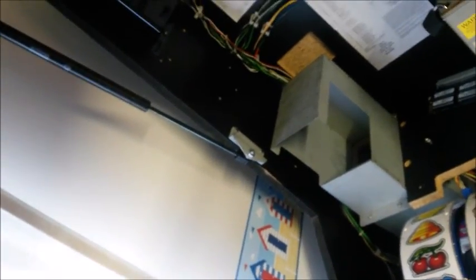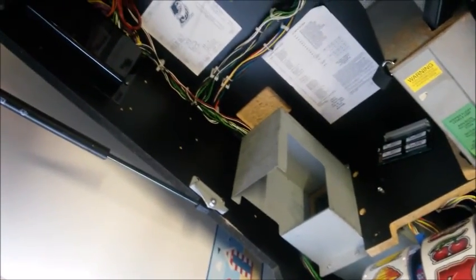First, I've just got to refit my reel. Get my reels refitted. Get your game card, plug it back in. Still leave the door open. Before you turn it back on, check your dip switch settings to be sure that you still have your note reader switches on. Also, if your game does not have this card on the back that gives all the dip switch settings, I recommend, it does work on some machines, not all, you turn every dip switch on. All of them. Turn every single one to the on position.